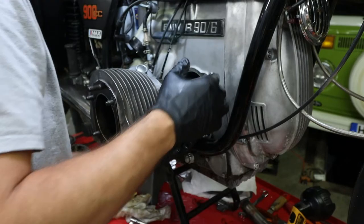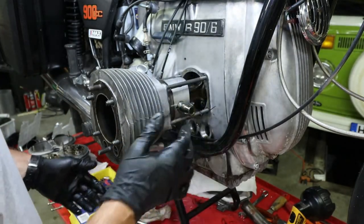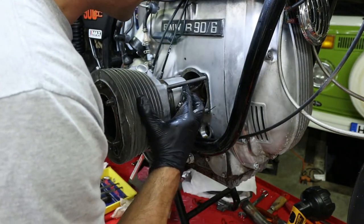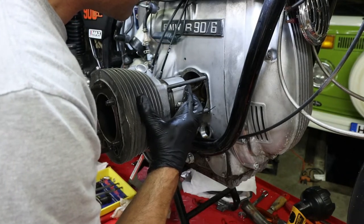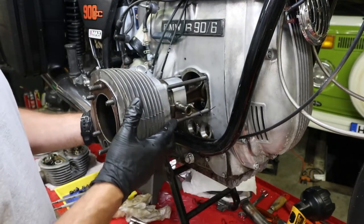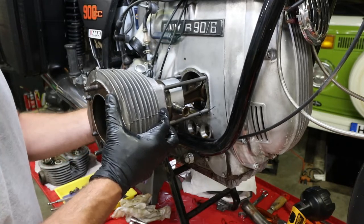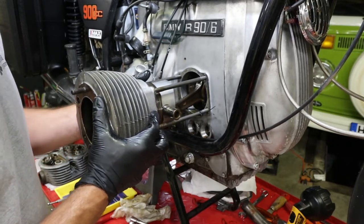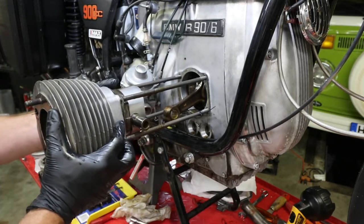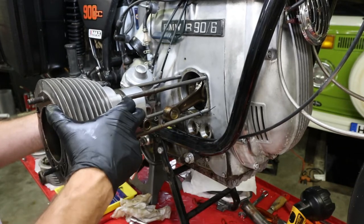And my connecting rod is now resting on the inside of the skirt of the piston. And now we can slide the piston ever so slightly back into the cylinder so we don't accidentally pull it all out and then have to replace the piston rings. And now I'm just gonna support the connecting rod, rest it on my zip tie, there you go, and pull this whole thing off. The base gasket is still stuck here, so they definitely used some sealant.